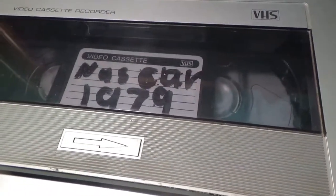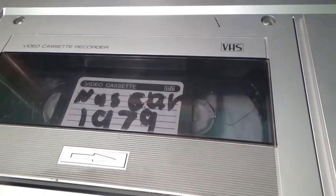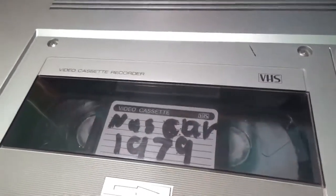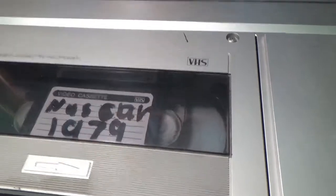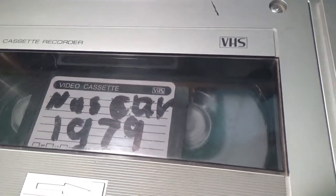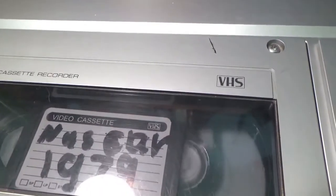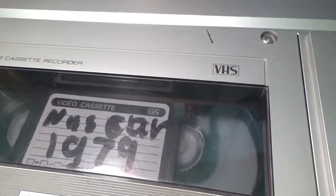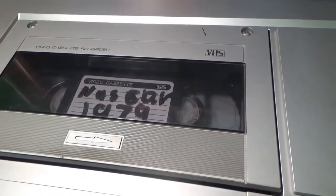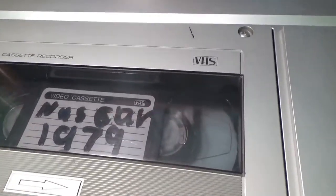Yeah, the relays. It hesitates. So to me, that's indicating that maybe it's old grease and it's having trouble getting going. Could be old belts. It's like it struggles to start. Now he said it didn't rewind or fast forward, but it does for me. But obviously it's got a sluggish takeoff. You hear a bit of a squeaky noise. I don't know if that's the belt or the tape. Yeah, see, I can't play.